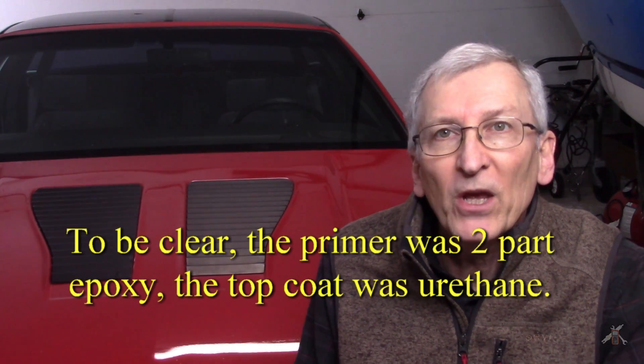The main thing when I went looking was I could not find a material that said in its data sheet that it was good for urethane. My question really was: what can I use on urethane? And it's a two-part epoxy. I'll go back and say that this original structural adhesive was also an epoxy, and the paint specified by the paint people was an epoxy paint to go direct to the urethane. So it all kind of lines up that it should be the right kind of adhesive. I can't give any guarantees, but that was what 3M recommended as a replacement for working on these old cars. I told him I was working on an '85 and what the bumper system was, and he was very helpful.